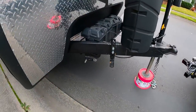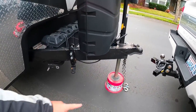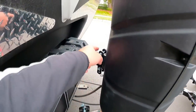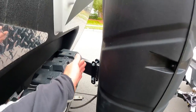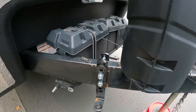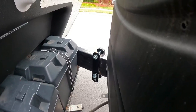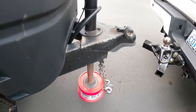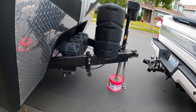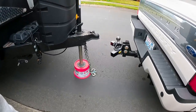It's a nice windy day here in the Pacific Northwest. One change we made: there were two individuals installing the hitch at the dealership - one working each side. One bracket was further back than it should have been, right at 32 inches. They recommend between 27 and 32 inches from the center of the coupler to the hitch bolts. That bracket was a little further back than it should have been, so we moved it forward about an inch to an inch and a half so they're now lined up. Just make sure you check your specific specifications for your particular trailer hitch - this is just guidelines for how we set up ours.